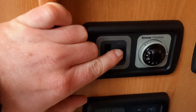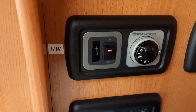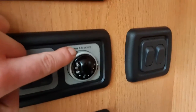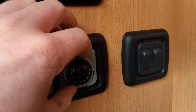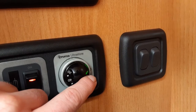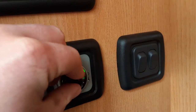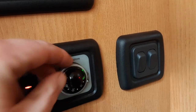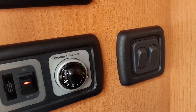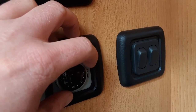These bottom switches control the hot water. The switch on the left-hand side with the red light is your hot water on electric — it is a preset temperature, 35 to 40 degrees, and you cannot control the water temperature. If you want to run the water on gas, you can — you'll see a flame symbol down the side. Spin this outer grey dial to the flame symbol; the green light is a pilot light indicating we're igniting on gas. If it fails to ignite, you'll have a red light appear. When on gas you've got a temperature gauge between 30 and 70 degrees of water temperature. You will need to use the gas system to boost the water when you are showering on board the caravan, even if you're on mains power. To isolate the gas supply, you turn the gas back off and it will turn the gas off to the hot water system.